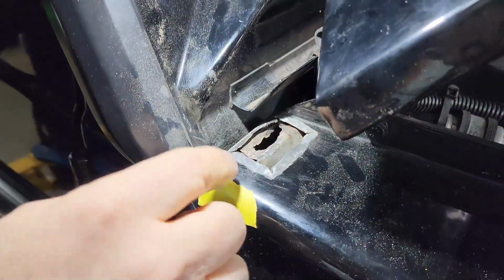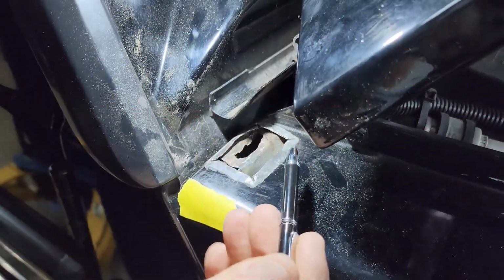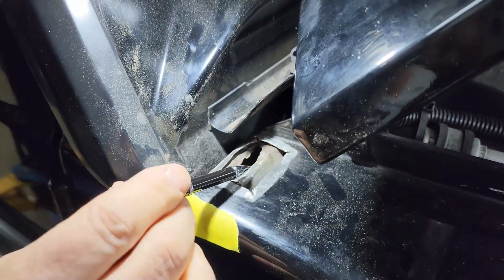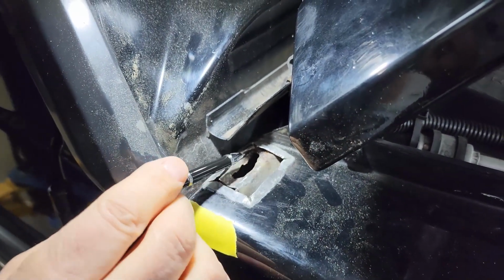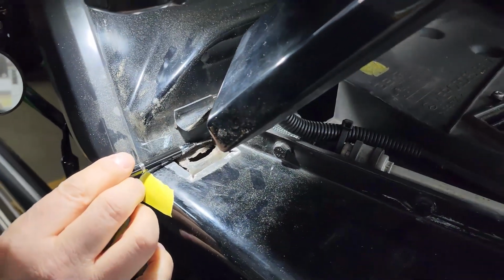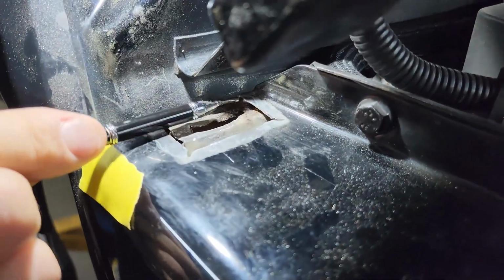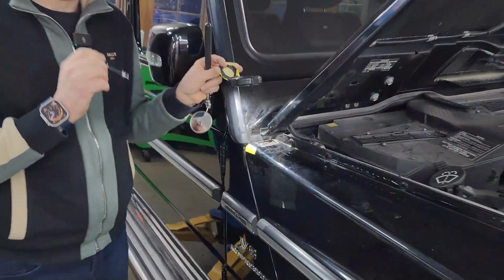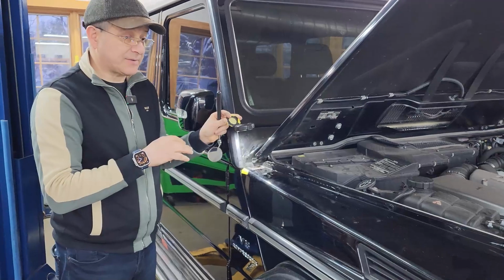This is the cowl, and the fender sits over it. So we're going to seal that off. That's not structural, and we have some good metal to bond to using that bonding agent, and then we'll have the metal plate sitting on top of that. So that should all work out. That's our recommendation, that's our plan, that's the most cost-efficient repair.